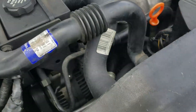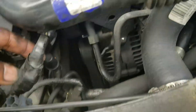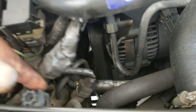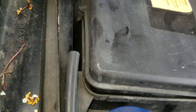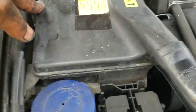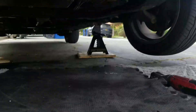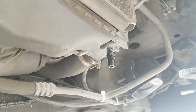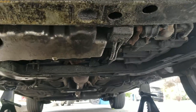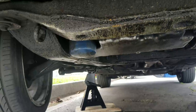This vent box hose is not quite in right. This radiator is missing a spacer that holds that in. Somebody's got it tied to some wiring here for some reason. The side of the air box clip is busted. But we're going to put this coolant back in and see if we've got any leaks. Nothing's dripping under here. The new drain cock is holding good, nothing dripping on the back of the turbo. We should be good to go — let's get these oil cooler lines blocked off.